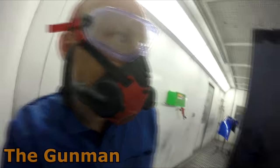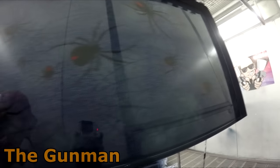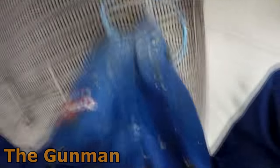So I gave that a good 15 minutes again, as I did last time, and as they recommend. Now I actually had a slow hardener with this clear coat, so it's pretty important that you do observe the flash off time. I'll just let you guys watch me put this next coat of clear coat on, and if you hang around for a few more minutes, you'll be able to see the kind of gloss that it retained after the next morning.